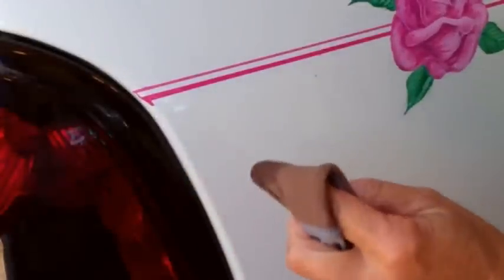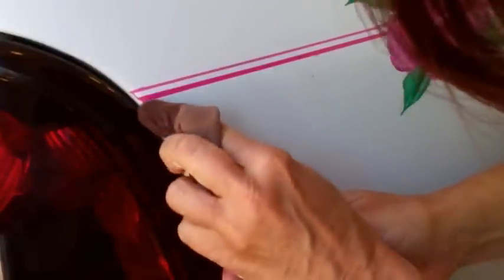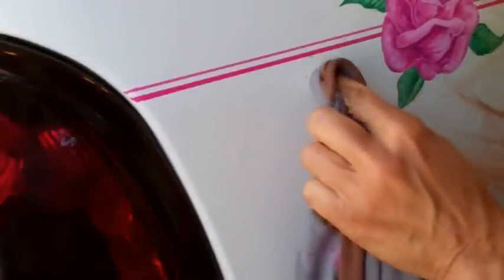I got a little bleed-out with the tape. Now that the paint has tacked up a bit, it's a lot easier to wipe these off — if you wipe them off right away, sometimes they make a bigger mess. If you have one of these tools, you can get them at any auto body supply or even Coast Airbrush. It's a really good tool for getting into little crevices without making a big mess of your pinstripe job.